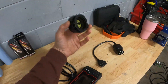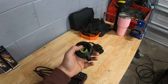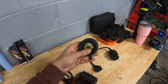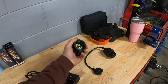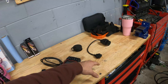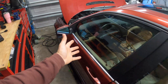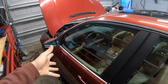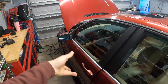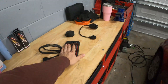Since I already have an extra cap here, let's go ahead and modify this one — I'll show you how that's done really easily. All you're going to need is a little bit of wire and a soldering iron. Once we've bypassed this cap, we'll have full module access from inside the car, so if you need to do any coding or reprogramming you can do it from inside the car. This is going to work with all your BMW dealer tools as well as any aftermarket scanners like this one.